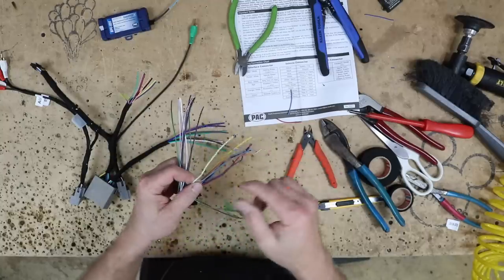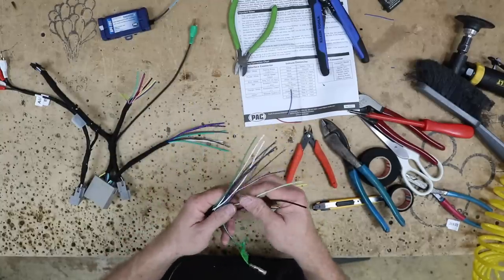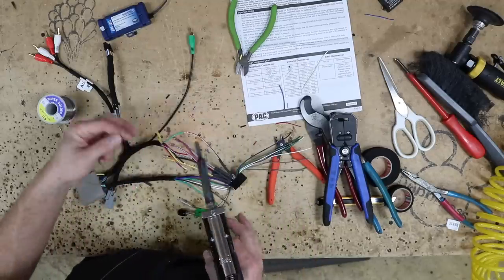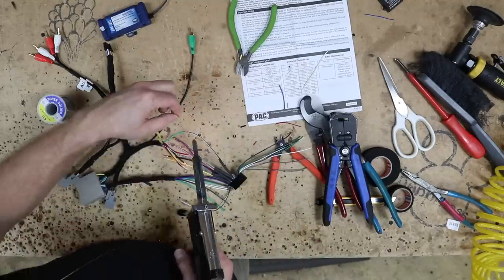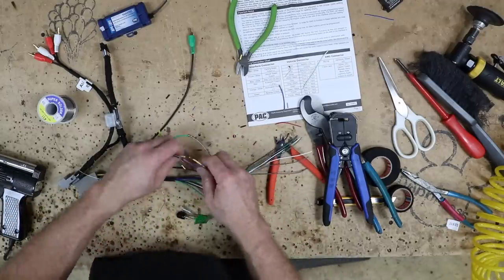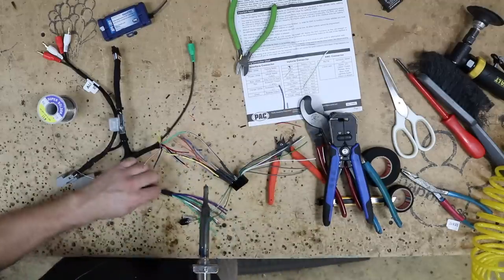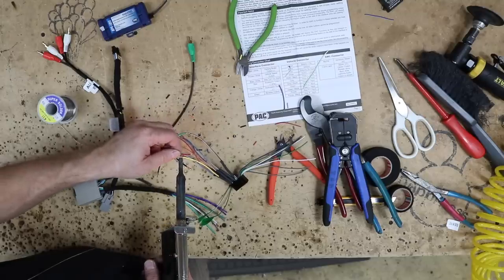And of course you have the light green wire which is the emergency brake. We're going to unlock the menus with this, so we'll attach the light green to the black wire. Now a good habit to get is anytime you're doing something where the green and the purple need to go together, do that first. The reason why is because a lot of times this becomes autopilot and you don't want to have to think about it after the fact. Always do the strange wires first.